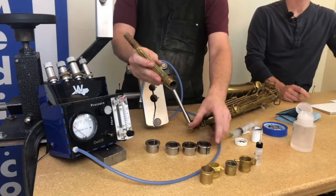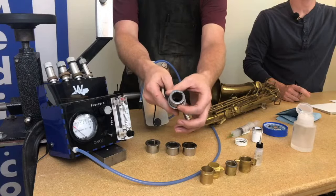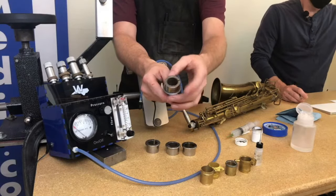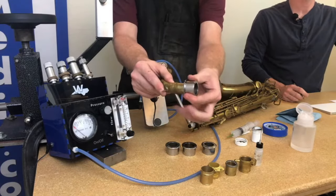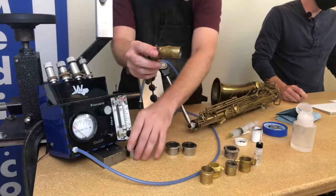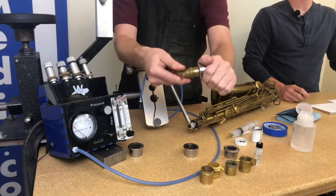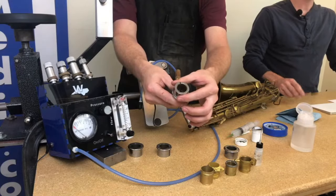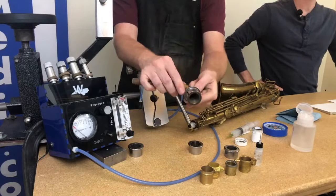The first thing is picking a collet that is the correct size. If I pick one that's way too loose, it's not going to effectively shrink down the tenon — in fact it would turn my round tenon into an oval tenon. So we're doing the Goldilocks approach: one is too small, one is too big. I'll use the one that's maybe a little tight — very close.